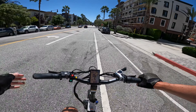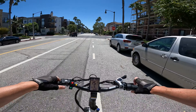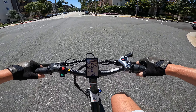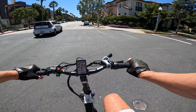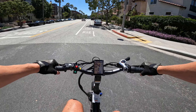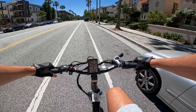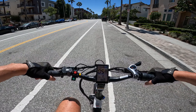The hand grips are not bolted down so they rotate easily — you could use some hairspray to glue them down if that bothers you. A subscriber recently asked how these bikes are to pedal with absolutely no power at all — honestly they kind of suck. This is like a 70-pound bike with a headwind, and you're going maybe five miles an hour. If you run out of battery, pedal assist one gives us three amps of current.